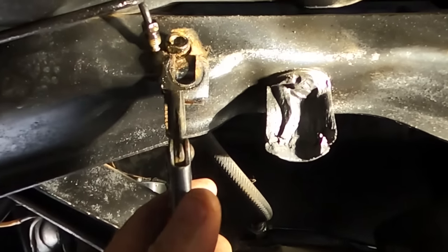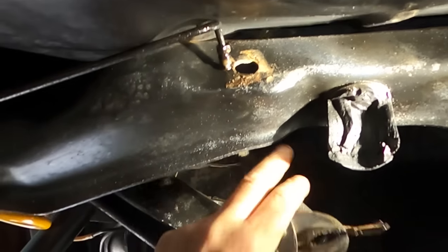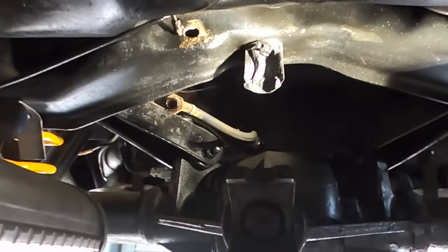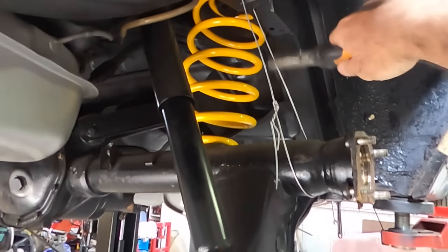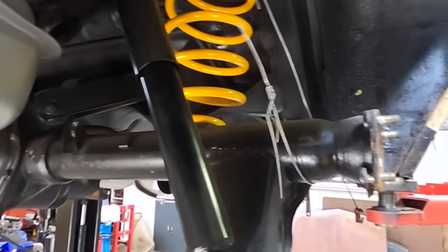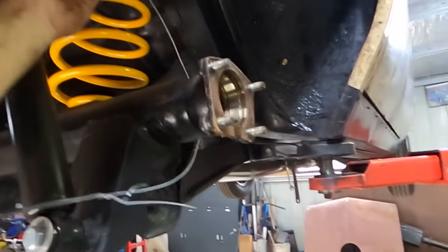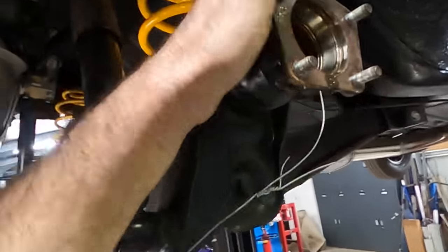And with that circlip off, that'll allow you to take that hose back through there. All right, start getting these arms off. And we'll just cut this wire. And before you spin out about cutting it, is it going to drop? The shock will bring it down slow. So I leave the shock connected and she'll just come down. Barely move, it actually barely moved. Maybe it won't come down. Maybe it was already down.